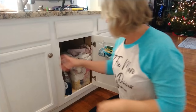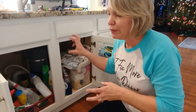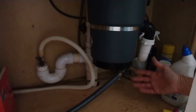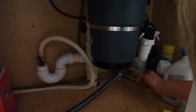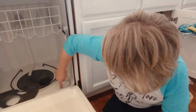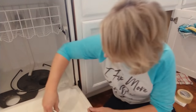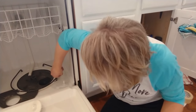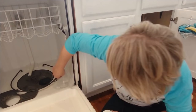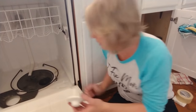Let the investigation continue. Something else I'm going to do is make sure that I haven't inadvertently turned the water down to a lower pressure that goes to the dishwasher, because I'm always down here doing videos. The valve that controls the dishwasher is this one right here, and it is up as high as it will go. This floater here — I think in mine it just kind of pops right out; on yours it might screw out. This will actually kind of rise and fall based on the water level in your dishwasher, and if it isn't sitting at the right level, that can cause problems too. I'm not seeing any kind of buildup though.